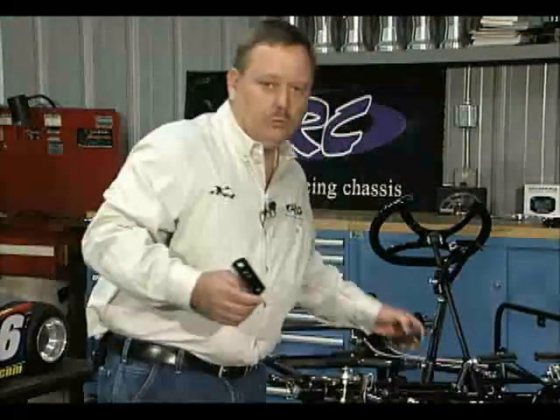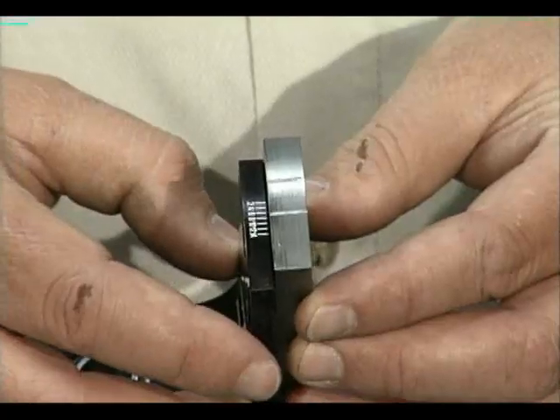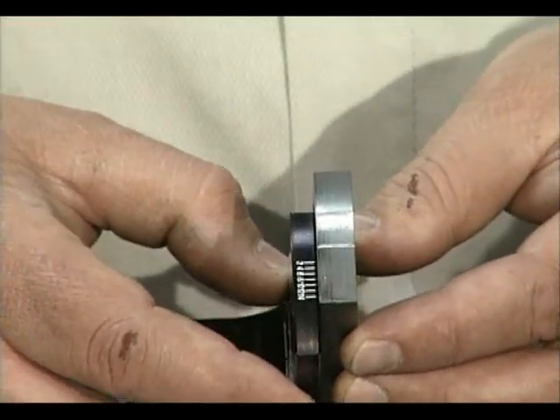The block pivots around the center pin. So after the block is installed without the top pin, it goes on the cart and allows the caster block to rotate to adjust to any caster setting that you would like to change to.